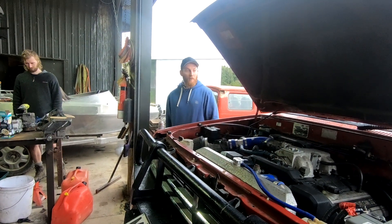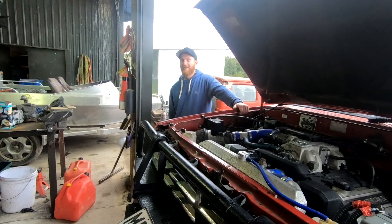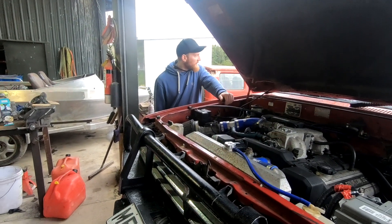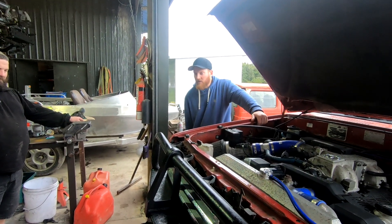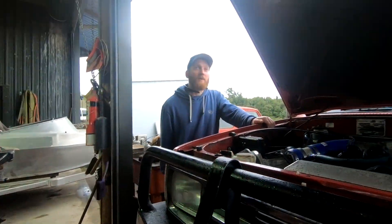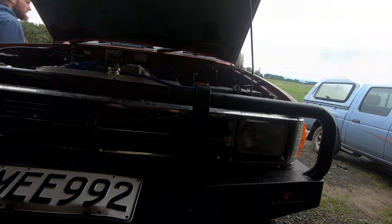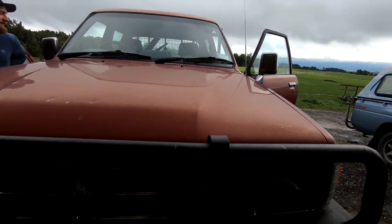How intermittent was it? It's like going blah blah blah and losing a lot of power, especially going up hills. Sometimes it'll run all right and then sometimes not. I couldn't believe it was running good as gold on the way up here. We could spend all day testing stuff and throw hundreds of dollars of parts at it and not find it. The igniters were definitely loose, and that bracket fell away when Jason took it off — that wouldn't have been good. When you're bouncing around it could definitely have caused issues.